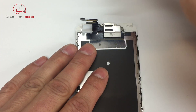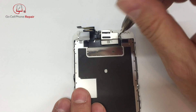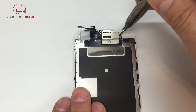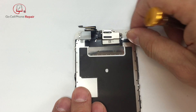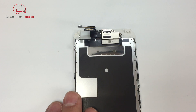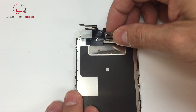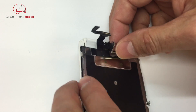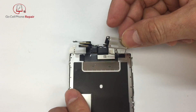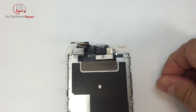There are three screws at the top of the phone. We're going to remove all three of these in order to remove the cover plate that goes behind the speaker. You'll notice that the screw on the right-hand side can get stuck inside the plate — be careful when you remove the plate so you don't lose that screw. There is a small adhesive loop that goes around the bottom of that metal box just below the cover plate, so carefully peel this away. It's fairly durable so it shouldn't tear, but keep it intact if possible — we're going to put that back into the new screen assembly.